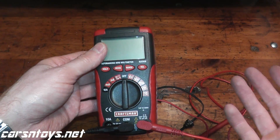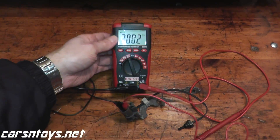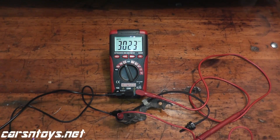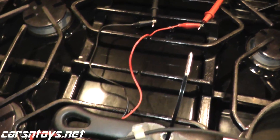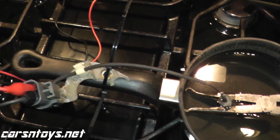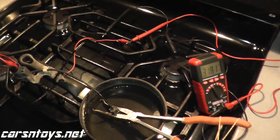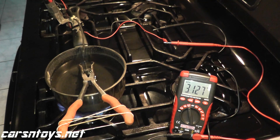Regarding the reading, you can place this on volts or resistance — resistance is the omega symbol. We already have a reading on the multimeter. As the water temperature increases, this number should decrease. Place the sensor into the water, turn on the stove, and we should see a decrease in the reading — this is a very quick test to verify if this sensor is working. One recommendation: don't use a pot that you cook in. Use a spare pot, because you don't want dirt and grime in your food.